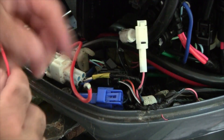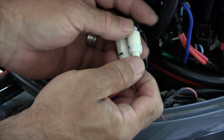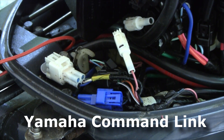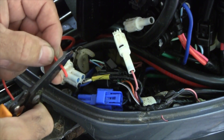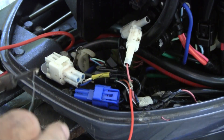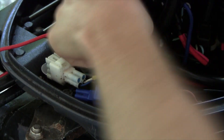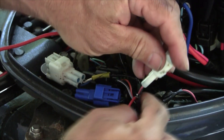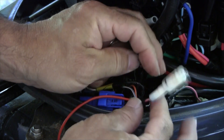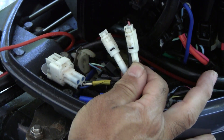I've tested it and it tested fine. I'm going to tie into this — I've put the plugs back in. One of the things I found out: you only plug those two connectors together when you're using the Yamaha gauges and system. We're not doing that, so what I'm going to do is use a fine gauge wire — I think this is 18 gauge. These were originally tied together with yellow tape.